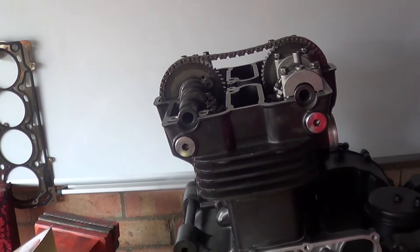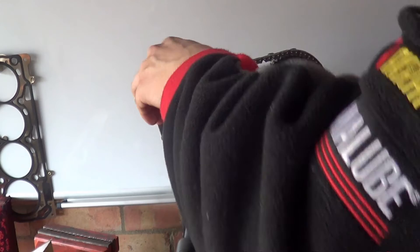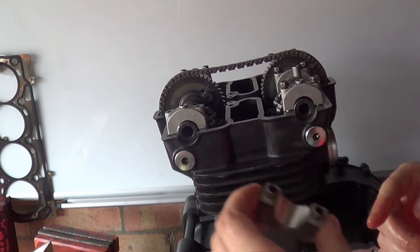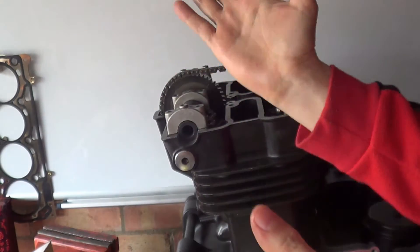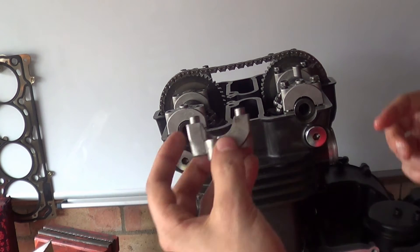So I've just been checking my old parts box and there is only one dowel per cap. But I've got loads of new ones, so I'm just going to stick two in. They've opted for two because there is a recess to accept the dowels in the actual caps. They've just cheaped out here because you don't really need them - the dowels are there to help with thrusting loads so these caps don't tip. Not so much alignment.